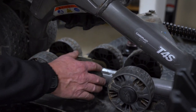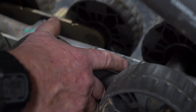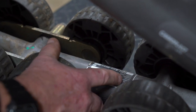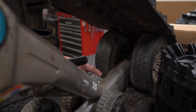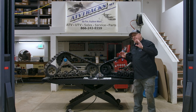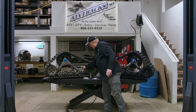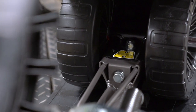All the tracks have a sticker on them. This one here is actually a Camoplast sticker for 6822. If this was made by Polaris — the Prospector Pro — it'll say 'Polaris made by Camoplast' and the serial number will start with 8522. This is the Prospector Pro, and it has a threaded rod for adjusting the track tension. Now on the Prospector Pro 2, instead of having an adjuster on the side with a nut and bolt, they have the adjuster inside. All these parts are made by Camoplast for Polaris.